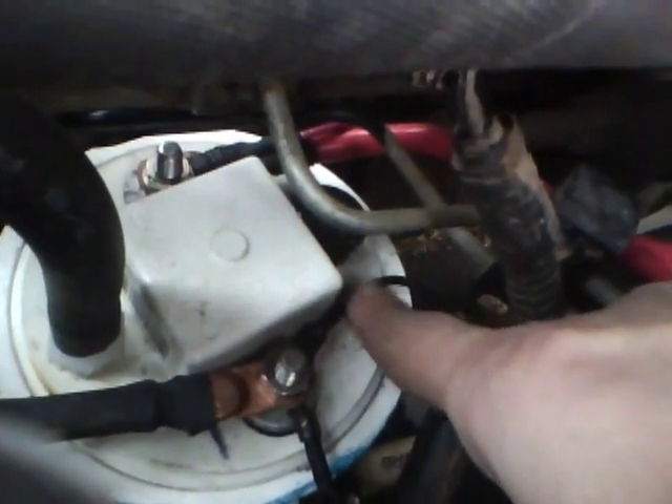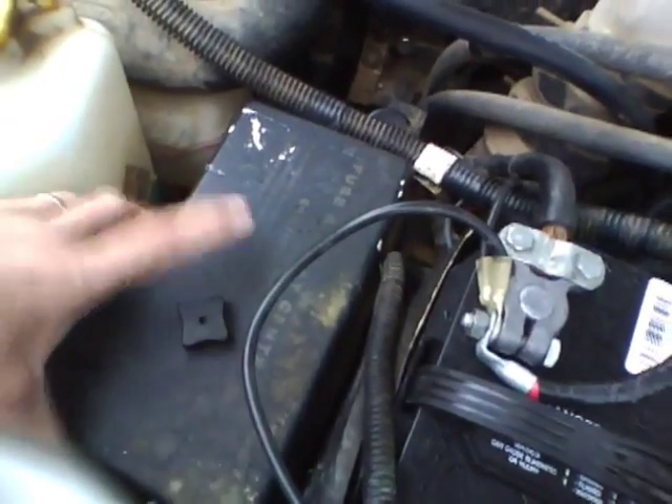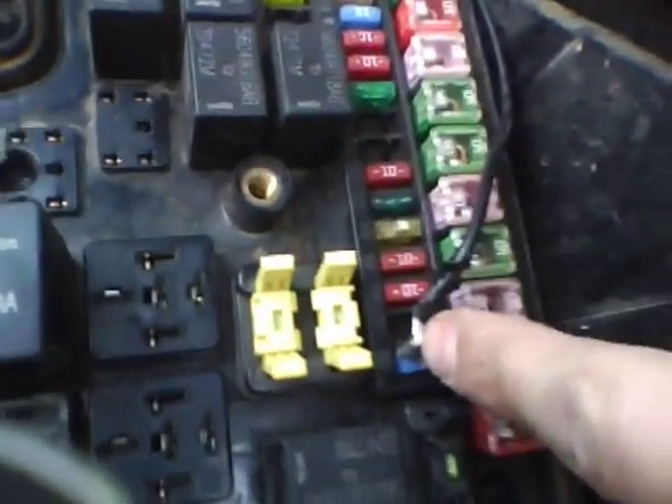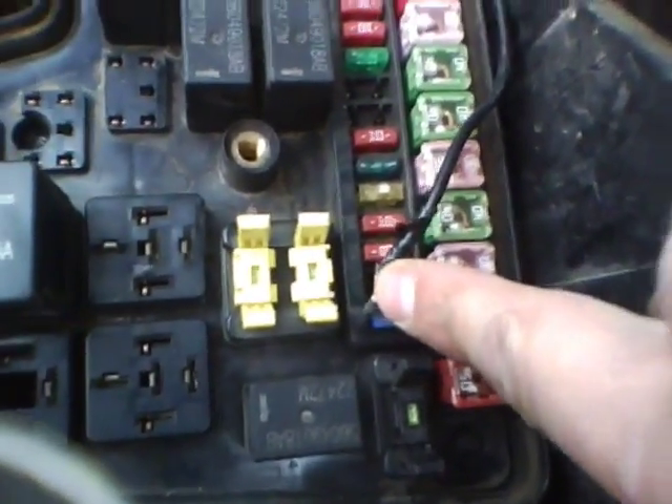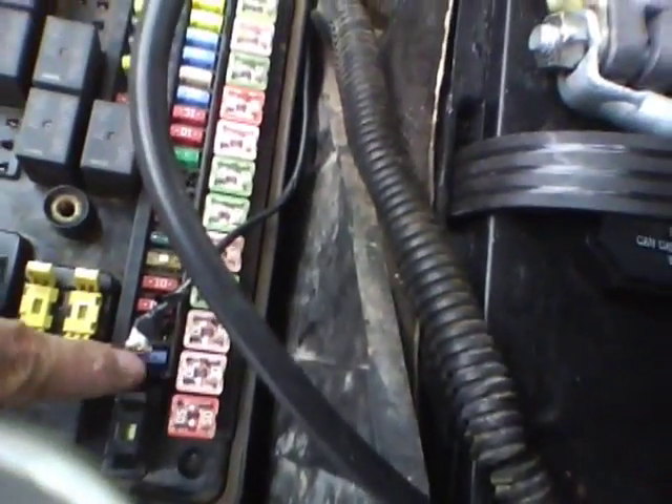Here you can see I have the voltmeter coming in on here, and this is my temperature sensor back there — kinda hard to see, wish I had a light. The positive is also right there for the voltmeter and for the switch. It goes off the relay, have the switch ran up in my fuse box here — and this is how I get the power for the switch. This particular fuse is only hot when the ignition's on — it's backup lamps — so it only activates when you turn the ignition on.